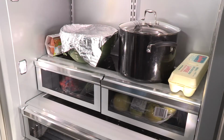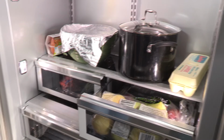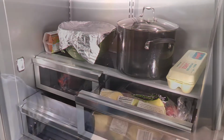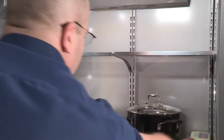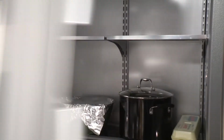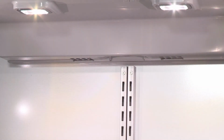During months of high humidity, especially if a home is not air conditioned, it is normal for some sweating or humidity to be seen on the interior walls of the fresh food section, on the bottles and jars. Opening the door frequently can cause sweating in the refrigerator compartment. When the door is open, humid air enters the refrigerator. The more the door is open, the faster the humidity builds. Opening the door less often will help control, but may not completely eliminate internal moisture.